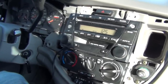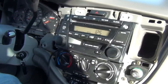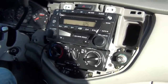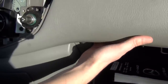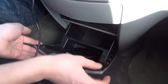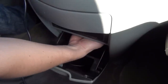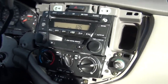Once you've tested it and made sure everything works properly and all the speakers work, you have to run the cables somewhere. There are basically two spots on this car: either the glove box — to get there you fish the wire through the side here using a coat hanger or, if you have skinny hands, you can get underneath and in there. Another good spot is through here; when the radio is removed there's a gap in the back where you can see your hand through, and you can feed the wire through the same way.